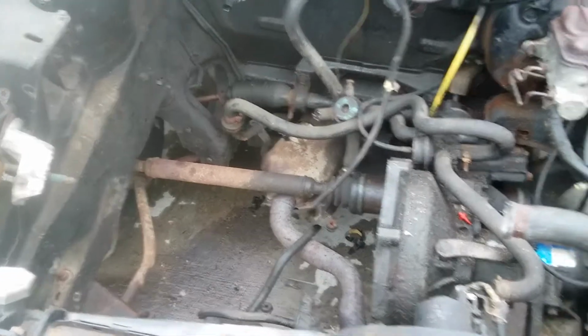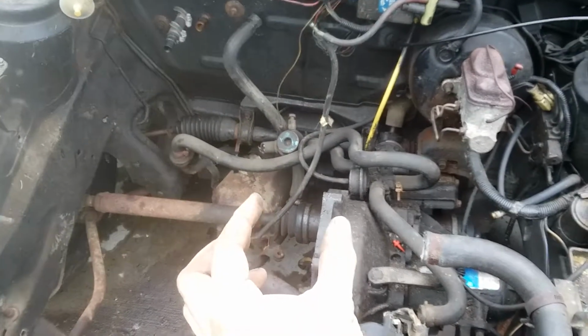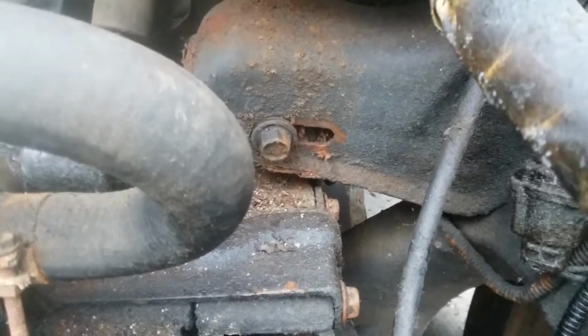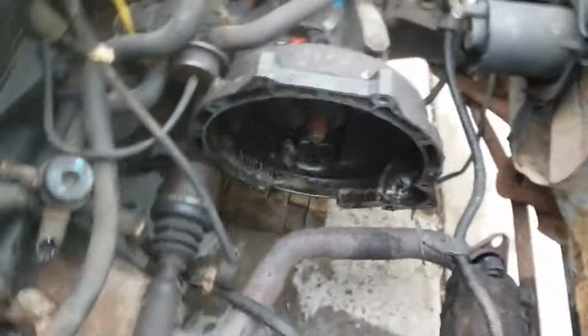But how I got the engine out was, I figured if I could move the whole thing over just a few inches, I could separate the trans and move the engine back over, because as long as you have about 2.5 to 3 inches between the tranny and the engine, it will come right out without any issue. So to make that space, I had to loosen up the bottom of that leading tranny mount, and loosen that bolt and nut on the rear tranny mount, so this thing could travel over a little over an inch, which was almost enough to pull the engine out, but we couldn't get around it.